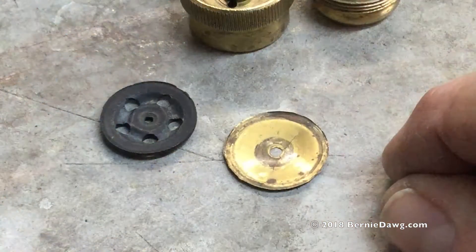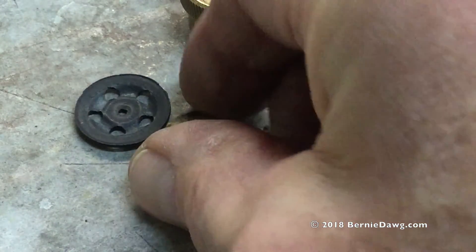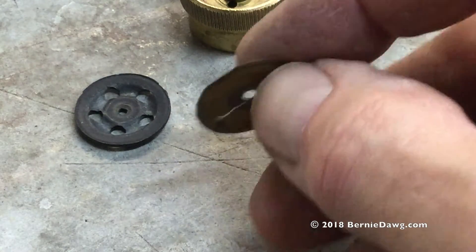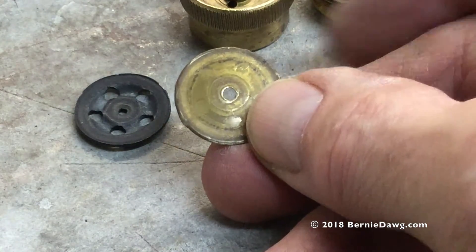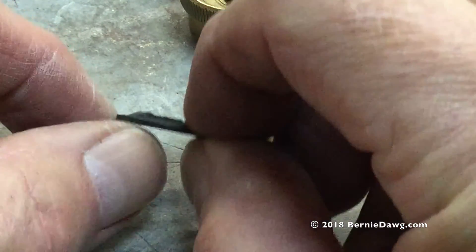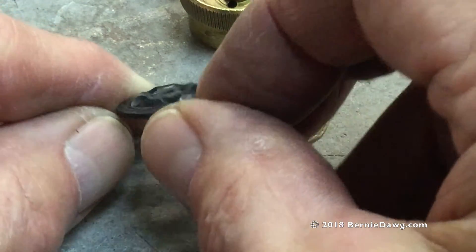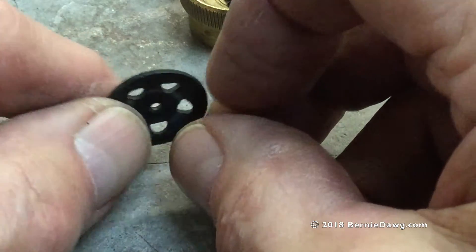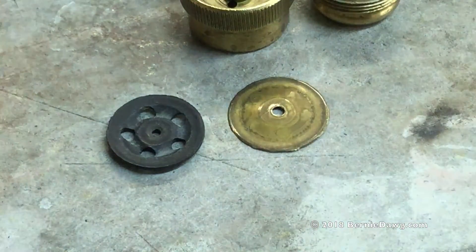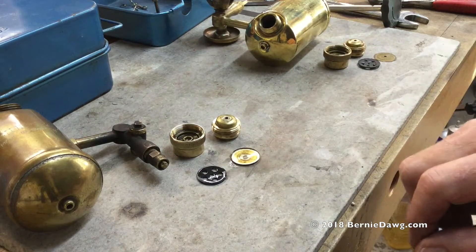Because the thin brass sheet is held deflected by the spring-loaded power of the piston, over time it develops stress cracks. Stress cracking of the brass seal will cause the safety release valve cap to fail. This rubber seal is hard and brittle, which is typical of what you find in most of these safety release valve caps. The constant exposure to fuel and subsequent age have caused it to distort and harden into this weird shape.